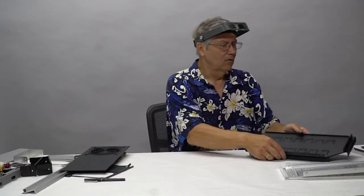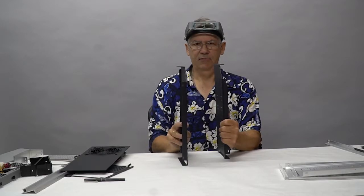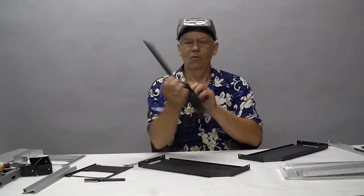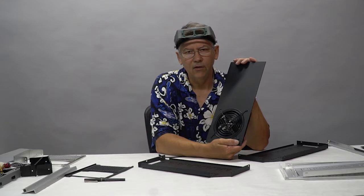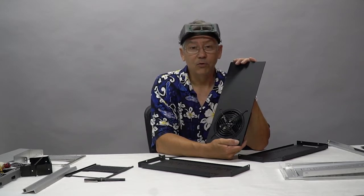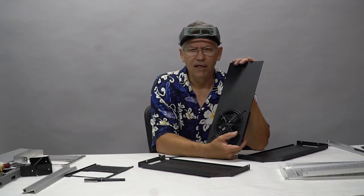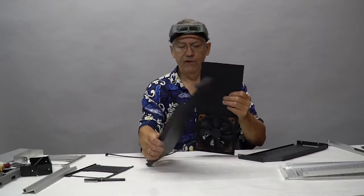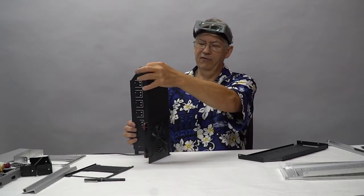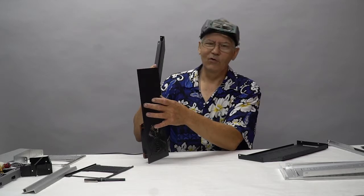Now, when these go in like this, we want to bring a fan into this to bring some air intake. So what I did was I cut a piece of 1 millimeter thick aluminum again, and I put a Noctua 140 millimeter industrial 2000 RPM fan on this thing. This will draw lots and lots of air in. It will be controlled by your motherboard so that you can set the fan curve based on the case temperature. It's gorgeous. When your case is cool, the fan doesn't run. It's really quiet. When the case gets hot, the fan kicks in. It cools the case. Now, that will sit between these two plates. Inside your case, it's going to, again, be very clean. This is going to give me some places up here to put like your clone drive switch and maybe a temperature gauge setup. We're going to really deck this thing out.